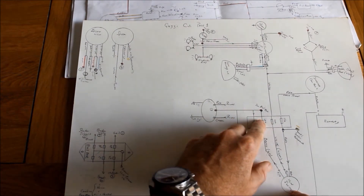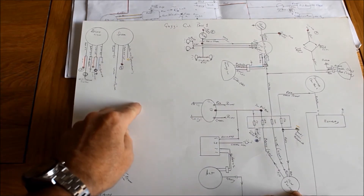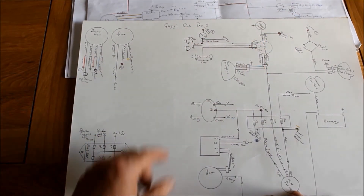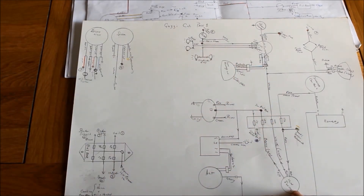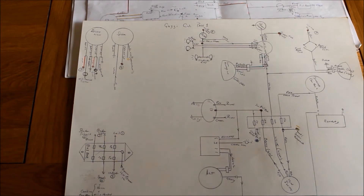That main wire has to power things like the idiot lights, the speedo, the speedo sensor, the horn, the indicator lights, and so on, as well as the starter motor and of course the ignition coils. In the past when I worked on a Harley they used circuit breakers with little posts, so you could take a power wire onto that post and spread it out quite easily without upsetting anything else. But on this bike I have nothing like that, so I've been looking around for something I can buy to suit that particular purpose.